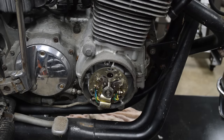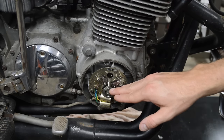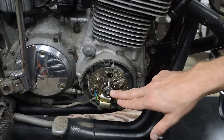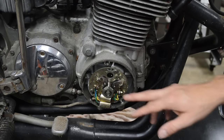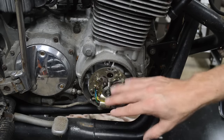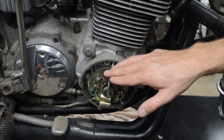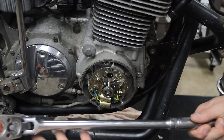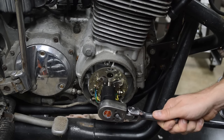After a few days, go ahead and try to loosen it up. What you want to do is directly drive the crank — don't use the kickstarter. Attach a ratchet right to the crank for the best chance of loosening it up. Also, look at the points assembly — this is a little shaft and mechanism. You don't want to torque the hell out of this because you can damage it. Choke up on the wrench and go easy — gently break this thing loose.